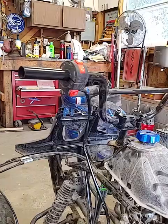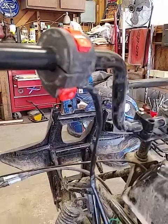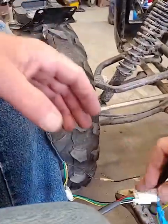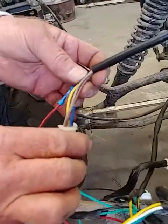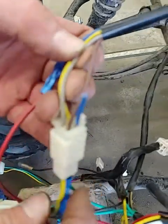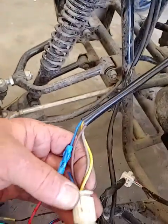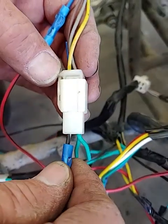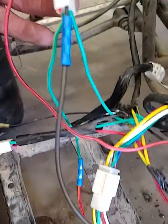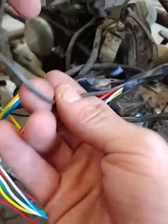The only way you can shut it off is the kill switch. Let's go over the kill switch one more time. The kill switch uses the yellow and gray wires off the switch — you'll see that on the inside when you have it apart. On the other side of the plug it's green, and then we use the existing black and white stripe safety wire — we just snipped it off a little bit. That goes to the CDI box on the center post.